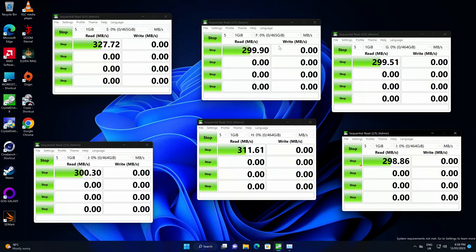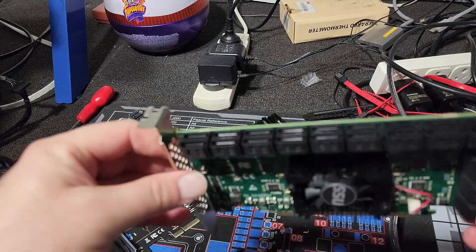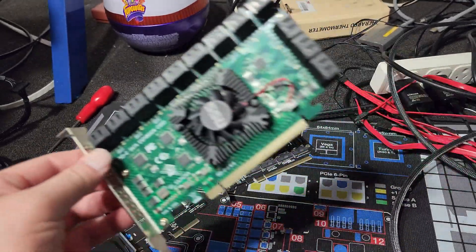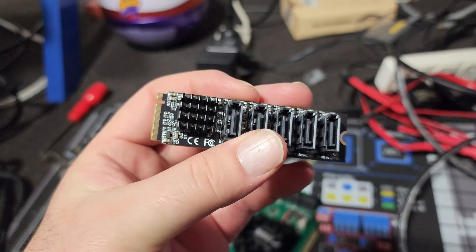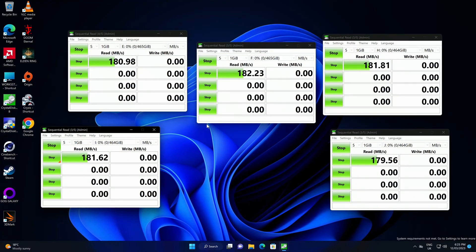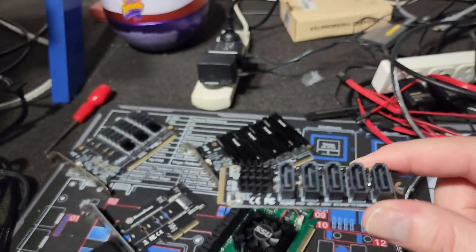As far as I could tell, this chip did a good job. My guess is this is actually a four PCIe lane device, which is good enough in my opinion. There is some overhead so I couldn't get full speed out of every drive. As for this little device, from testing it appears to be only one PCIe lane, so you should expect about 900 megabytes per second. You could plug in three or even four hard drives, but just keep in mind your bandwidth limit and the overhead from the SATA controller. The motherboard I tested it on recognized it no problem.